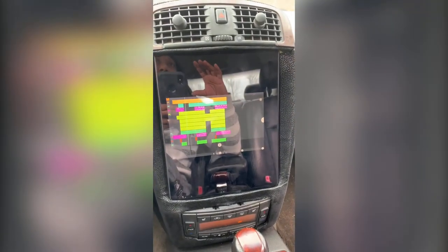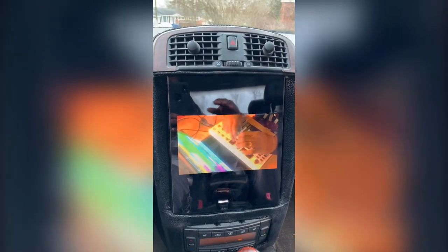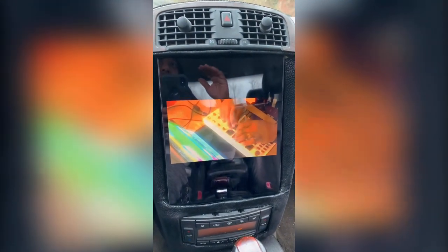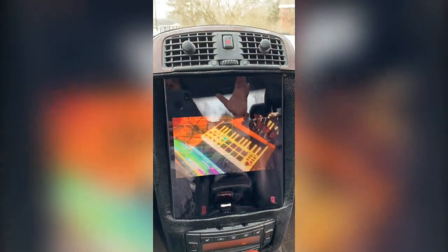And then you're going to pretty much sandwich the boards, because there's like three or four boards plus the screen if you have the DVD navigation system. So all I did was between each motherboard, I just put a piece of cardboard in between it. It's not the greatest, but it works. I put a cardboard between each motherboard, and then I just wrapped it in electrical tape. You'll see here in a second, because I'm actually going to take this out. And that's how you do it.